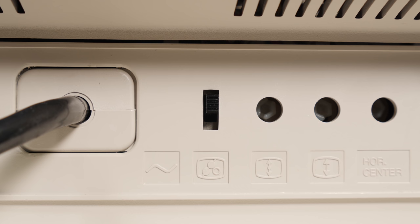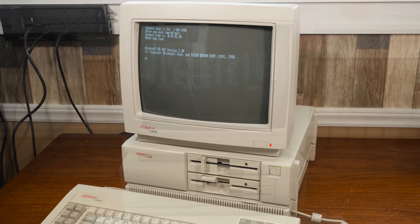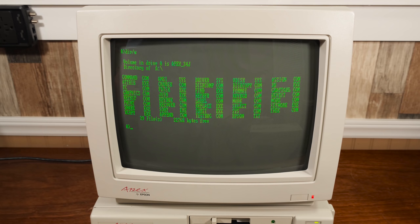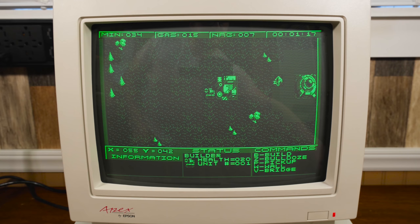Wait — this is a color monitor, why does it have a mono switch? Let me power everything on and show you. Being that there's no hard drive, you do have to insert an MS-DOS boot disk on startup — in this case an Epson OEM version of 3.20 that I've reproduced myself since the original disks are long gone. About that monitor switch: it straight up makes everything green, mimicking the look of monitors like the IBM 5151, except it's still CGA running underneath. So you can run a game with four-color graphics like Planet X3, but it'll look like it's running in monochrome on a green phosphor display — kind of.